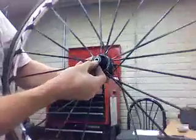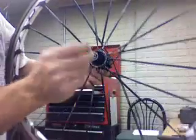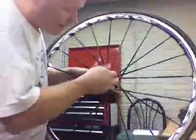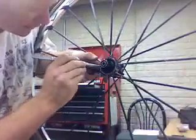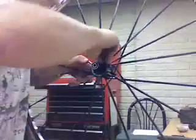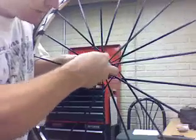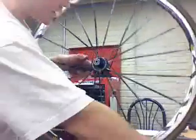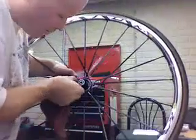There's a small washer that sits right here on this bearing, between the bearing and the freehub body — keep track of that when you put it back in. Clean this out really good. Once you've removed a lot of the grease, carefully remove the gasket. A lot of times this is still good — you just have to clean it up really well. Be careful you don't tear it; it shouldn't be dry or cracked. Set that aside and clean the inside of the hub really well.